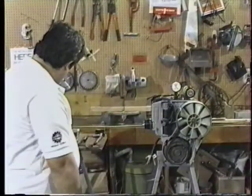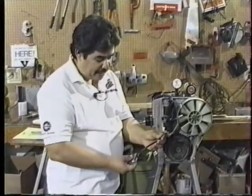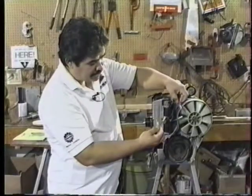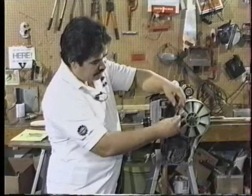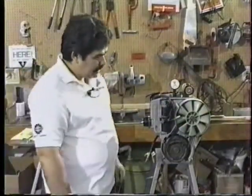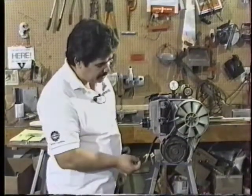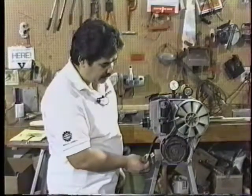The other device I've removed is the dampening box. The red wire goes with the red tracer — normally this would be hooked up here and this to here. We'll again remove the dampening box. Now at this point we're going to remove the flywheel just to make it easier to see the workings of the points, and we'll go ahead and remove that for you.